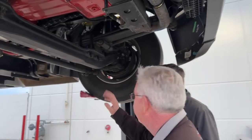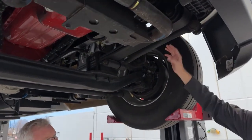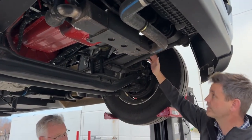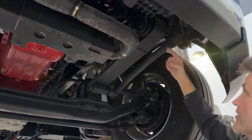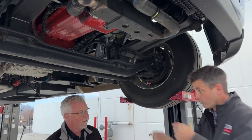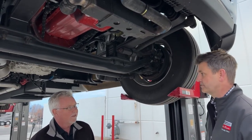It's a solid front axle. What keeps it from jerking you off the road when you hit a big pothole? It comes down to geometry. You have a spring up front, and as it goes up and down your tire goes up and down. The steering linkage from the pitman arm — there's a gearbox and a pitman arm here — its pivot point is on the exact same pivot point as the spring hanger. Because they move together, your steering never jumps around. That's called bump steer, and we've eliminated it.